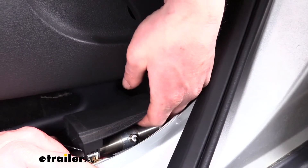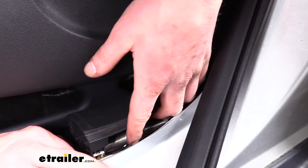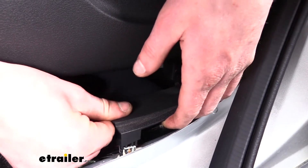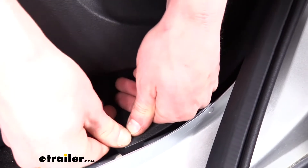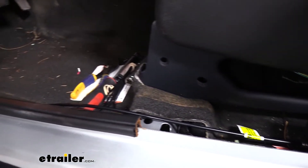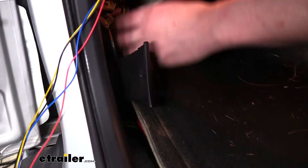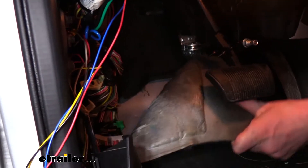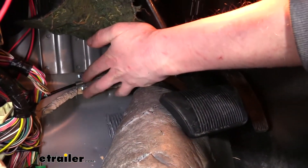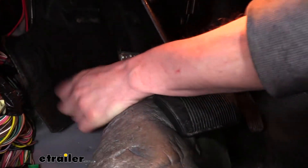This is the smaller hose that comes included with your kit. Slide it back up in there and put it back in place. This cable was then routed towards the front — what you're seeing is the cable sheathing, not the exposed cable at the pedal. It routes all the way down the front and down the carpet. Pull the carpet back and it actually runs behind the paneling here. Wait to mount this portion until after you have hooked it up to your pedal bracket.